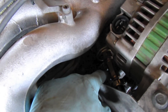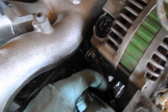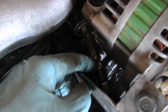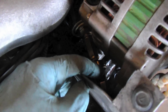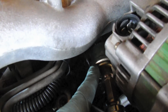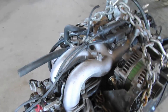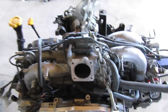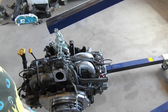I've added an eighth-inch NPT short nipple that goes to a T. Down in here is the original oil pressure sender — all it does is click on a warning lamp on the Subaru dash. What I've done is put an electric sending unit that's going to go to a gauge up on the dash of the bus. That basically summarizes the engine prep — it's pretty much ready to go in. The next video we're going to walk through actually putting this into the bus, so stay tuned.